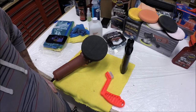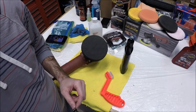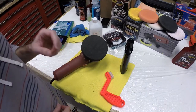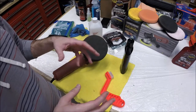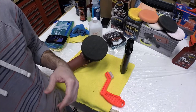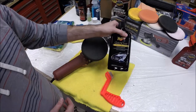We're down to our final step in the process. By this point you've washed the car, clay barred it, done the compound, and polished. If you need to apply any touch-up paint, that would be the time to do it after you've finished polishing. I had a few spots in the front bumper where I did some touch-up paint. Typically you should wait a couple of days for the touch-up paint to finish curing before you go over it with the wax — it'll help it adhere a little better. It's tough if you're trying to get everything done in a single weekend, but for me it worked out since I only have time on weekends anyway. Now we're ready to apply our wax.